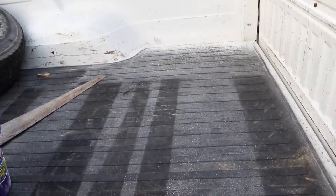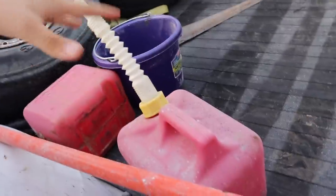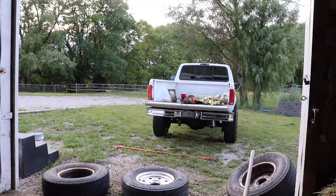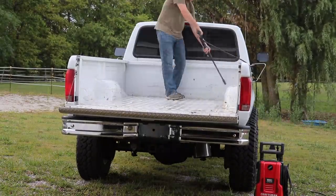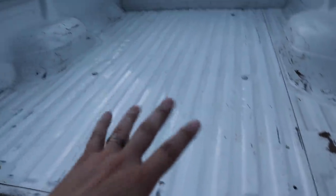The mat's been in there a long time so there's not much wear on the bed itself. We're going to take the wheels and tires out, remove everything from the bed, pressure wash it, and get it prepped for the new bed liner. I took a sanding block and worked the whole main flat bed surface — the sides too — really focusing on getting all the debris, dirt, grime, oil, and grease off the main bed surface where you need the most strength and contact.